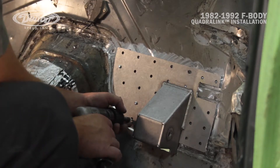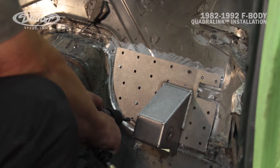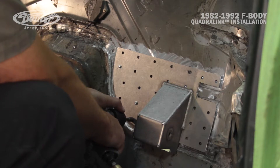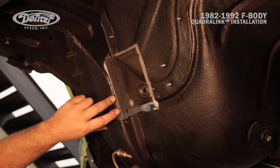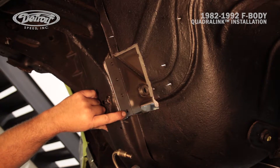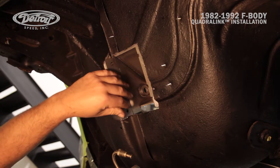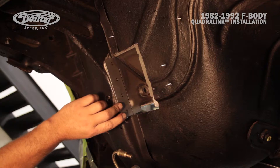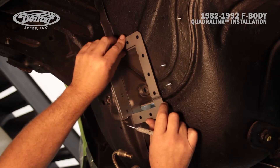Just remember, before you put the screws in, make sure that 8 and 5 eighths measurement is the same from the top of the trunk pan to the top side of the bracket. Take measurements at a couple of different locations to make sure it's straight and square to the vehicle. From the underside of the vehicle, the plate should also be pushed outboard against the frame rail — this will set the appropriate span. When viewing from the bottom, the flange that hangs through the floor will not contact the entire length of the frame rail due to the angle of the frame. Mark is going to line up the doubler plate and make a mark on where to grind away the paint to give a nice clean plug weld.